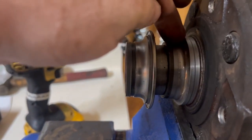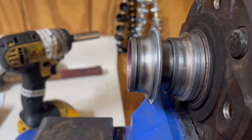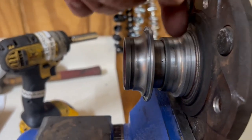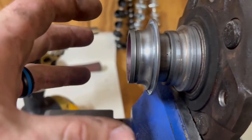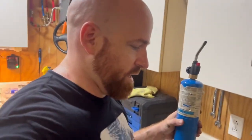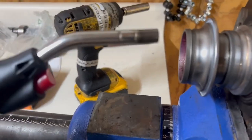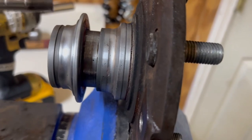There are a number of ways to get these races off. If you don't care and don't need it, you can cut into it with an angle grinder or a small cutting wheel on your Dremel, and then it'll split with some force. Or you can heat it up and pull it off. You get the feeling I'm about to do a combination of things. So we're going to get the torch and heat up this new race — and hopefully not destroy it — get it off there, and then see what I can make happen with that race on the back.